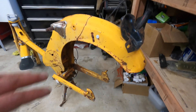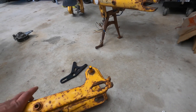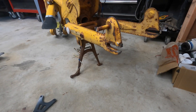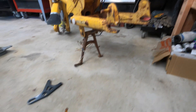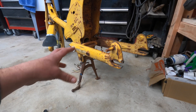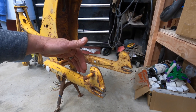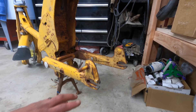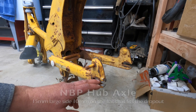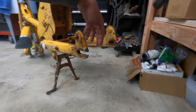Specific modifications to make the bike actually work: you're going to modify the rear swing arm. The old style rear wheel had an axle that slid in, while ours doesn't. So you have to actually cut the back off here and slide the rear wheel in. The rear wheel has a few issues. This is 170 millimeters, and the new rear wheel is 150 millimeters. Also the new rear wheel is 10 millimeters high where it needs to go in the dropouts. These are 15 millimeters on this side and 12 millimeters on this side, so you're going to need to take up that space.